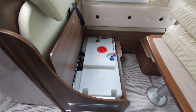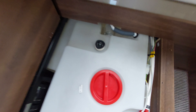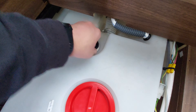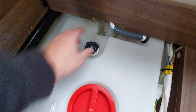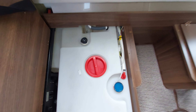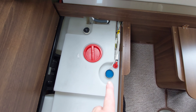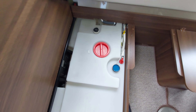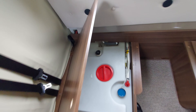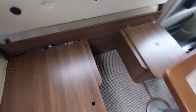I'm going to start with the cushions up just so this will give us access to the fresh water tank, which is under your forward-facing seat. Before you fill up your water, you need to turn this little dial clockwise — the first click will fill up to 20 litres, then all the way will fill it up to the top. You can fill it up manually by moving the red cap. The other one is just your level sensor. That's where your fresh water is located, under the seats.